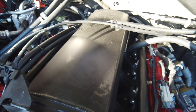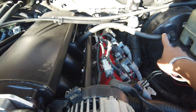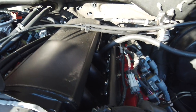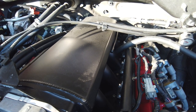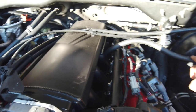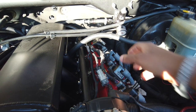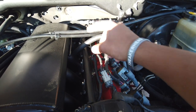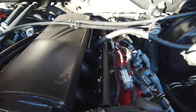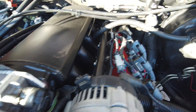There's a couple more things that I kind of eliminated. Like I said, all your brake booster vacuum, all the bungs are underneath the manifold. Also put those bad boys on before you put the manifold on. You got to use a big bung for the brake booster. They give you an assortment of them. You only need one big one, two medium ones, and there's one small one. The small one is for the fuel. So yeah, there's that. What else?